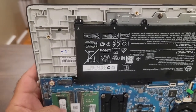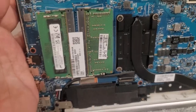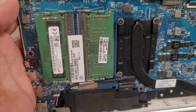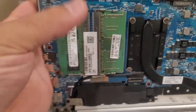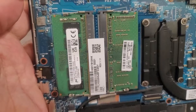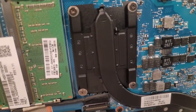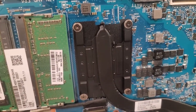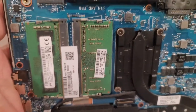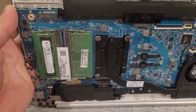I'm again strongly advising you to use the M.2 drive for the operating system. Now here's the most important thing everyone wants to know: can this laptop accept more RAM? Here's the answer. You can see here one RAM stick is 8GB and the other is 4GB, which means we can just replace the 4GB with an 8GB stick and then we'll have 16GB of memory.